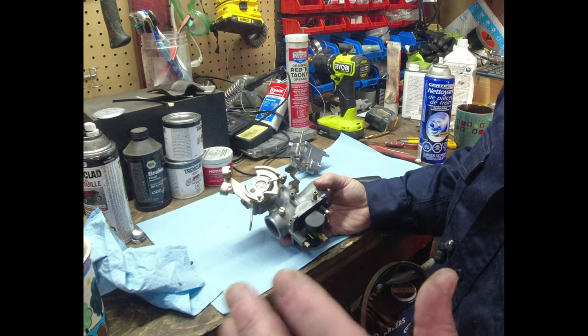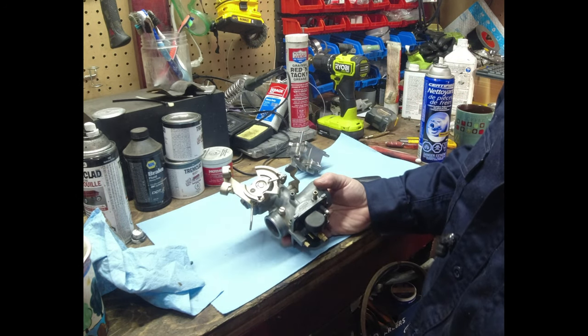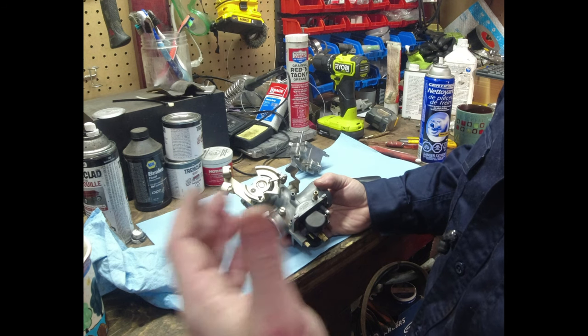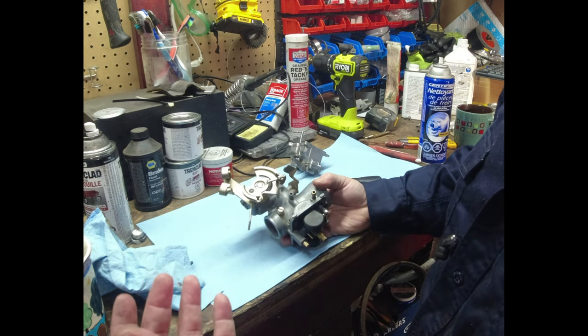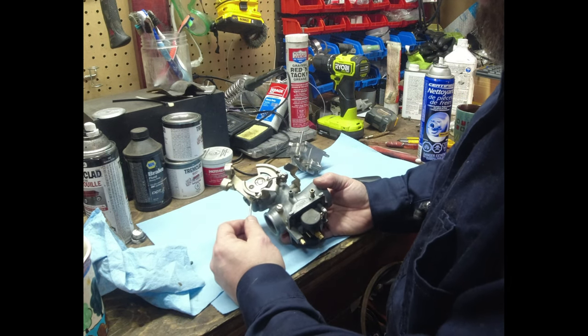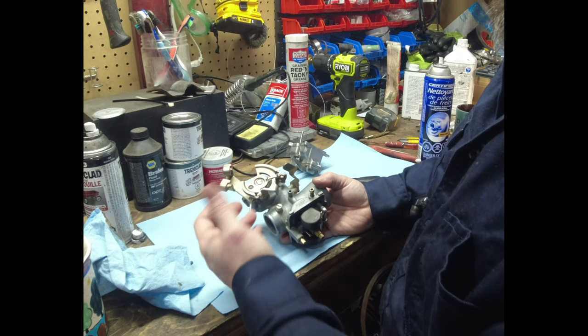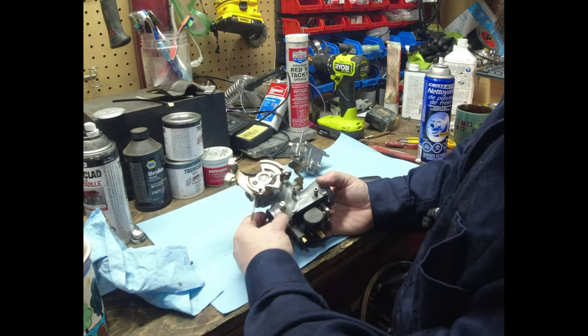You can do it with some propane too, and I do have some of that, but I just assumed that this, and you shouldn't assume, however, this has been persistent past that. So I know that chances are the problem has been the same. It wasn't the carb boot before, so it's probably still not the carb boot now. There's something else going on. But if I go through this and I can't find it, when I reseat this all, I'll probably retest that. I'll do a leak test.